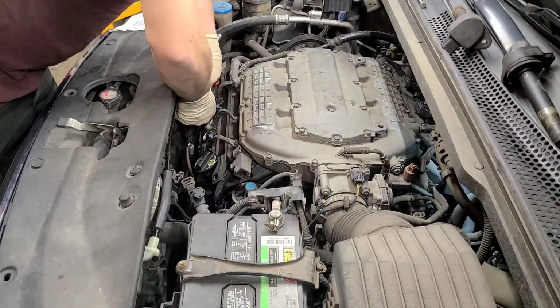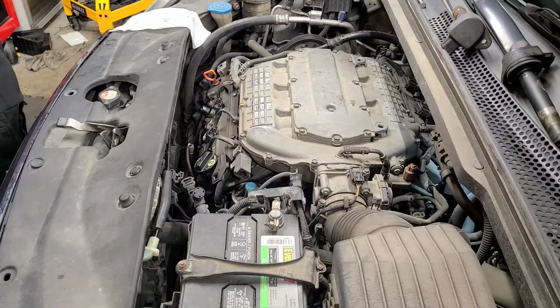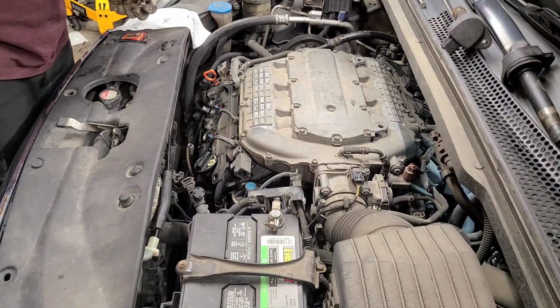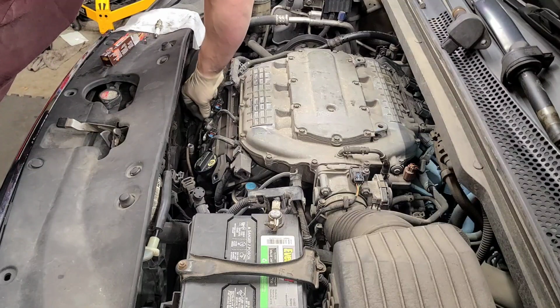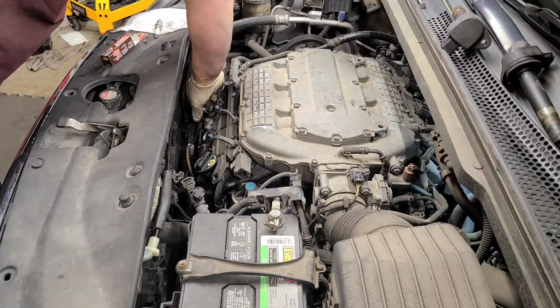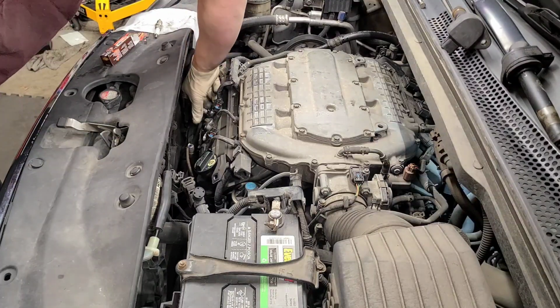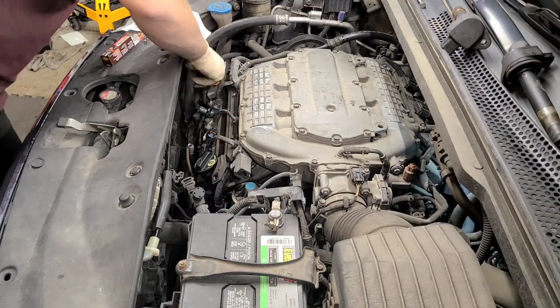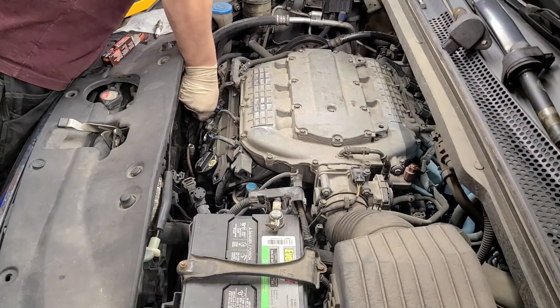And we'll start with this one. Removable. Let's get us a new plug. We have already matched these guys up. So set that there and proceed on backing this one all the way up. The main thing is taking your time, and definitely you don't want to cross thread these. So definitely take your time.